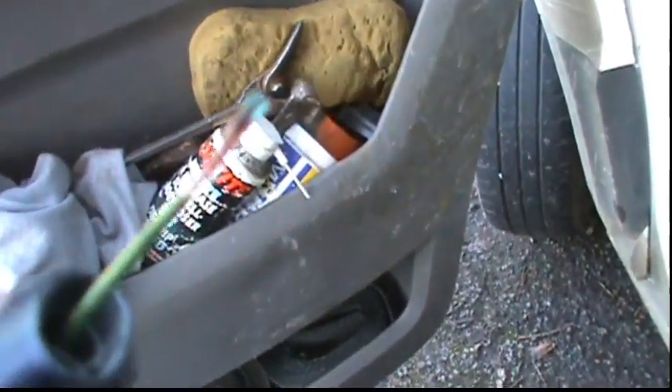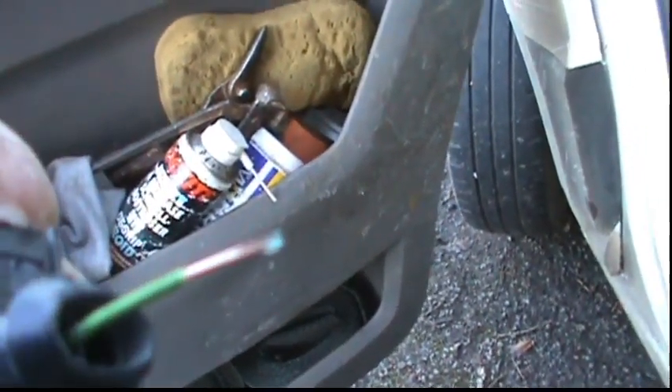And what did Trev find? This is why it's only a quick one because we've already done the Land Rover. Can you see the green corrosion on the end there? Another one that's broken at the end - that's the reason why. It's a weird one though. The Land Rover came up with faults, but the Crafter just sorts itself out and charges at 14 volts. I'll get this soldered up and show you the result.